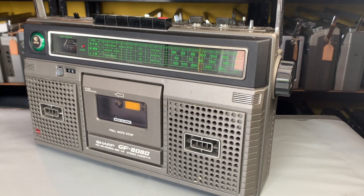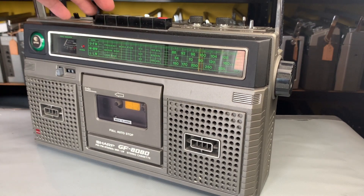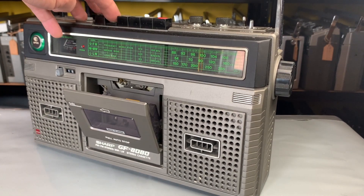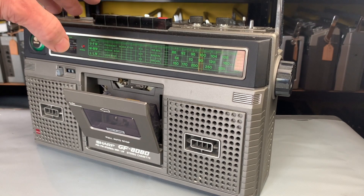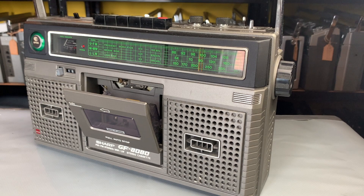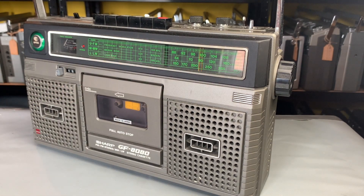Today is just a quick belt change for anyone that wants to do that, so they can dip into this quick video and see how to change the belt. A quick word of advice though: a lot of the time with this particular unit it's the grease that gums up as well. If it's going into auto-stop mode, or if the controls are slow to return because the buttons don't always come back properly, that'll be a lubrication issue. Check out my other video for that.